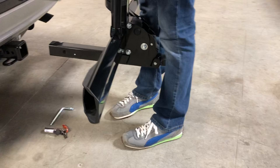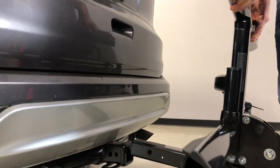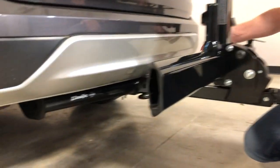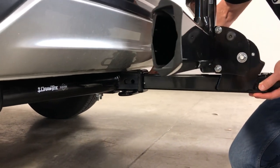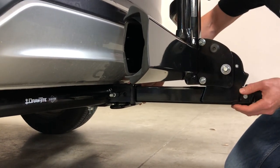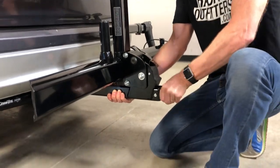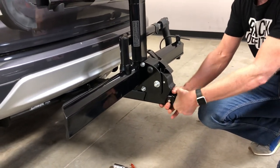I'll go ahead and demonstrate how that works. When installing and removing the rack it's always best to do that when it's in this right-angle position — that way you don't have to extend your back over the rack. You just drop it down onto the bottom ledge of the hitch, bring it up to a horizontal position, and begin sliding it inward. Before you slide it too far, take your hitch pin and put it through the hitch pin hole — it'll be touching the side of the stinger — and continue forward until the hitch pin goes through the hole, acting as a feeler. Once it does, pull back and begin tightening this knob, which pushes that ball bearing into the corner of the receiver hitch. Get it good and snug, and you'll have a very rigid connection to that receiver hitch.